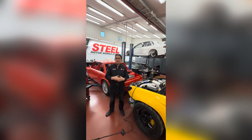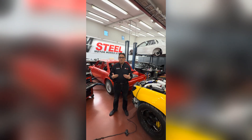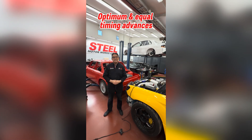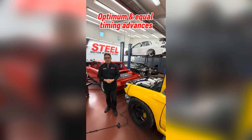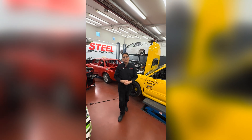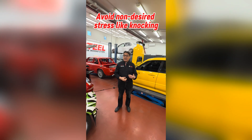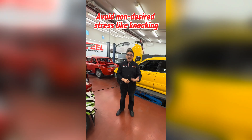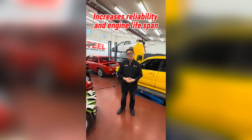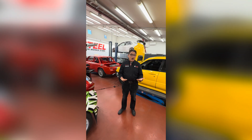The primary chamber is of a conical or tapered shape, and this is what guarantees and ensures the uniform airflow. The advantage of the uniform airflow is that you can set the timing advances at an optimal level and equal to all cylinders, which means you can get out the best top power and torque of your engine. It also means that you can avoid undesired stress factors like knocking, which increases the reliability of the engine and extends the lifespan.